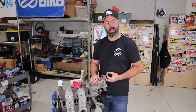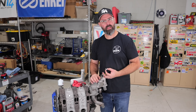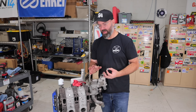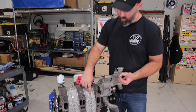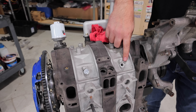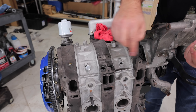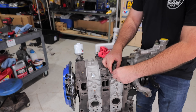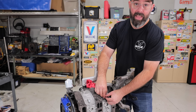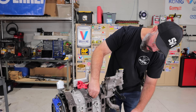Now that we've got the clutch and flywheel in place, we are moving on to installing the intake manifolds — plural, because there are basically two parts. But before we install that, we need to plug these two holes here — you can see we've plugged one already. These are for the oil metering pump system; normally there's a fitting that feeds and injects oil to the apex seals. We'll go into more detail on that later, but for now we just want to plug these up with the OE crush washer.